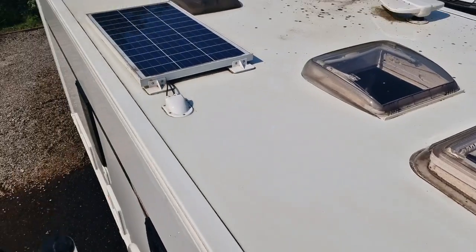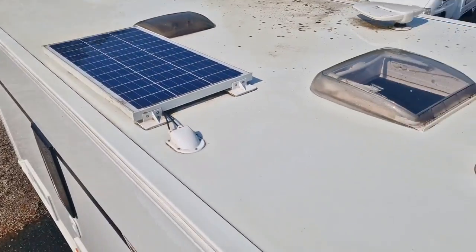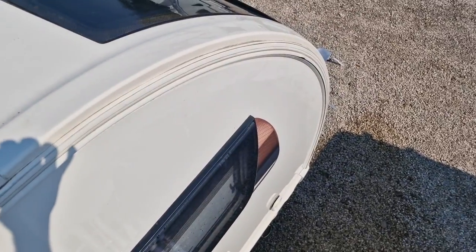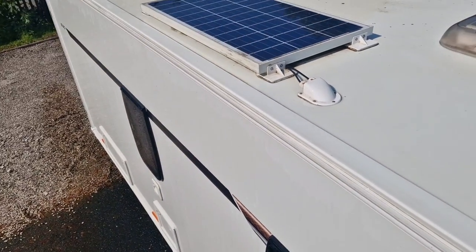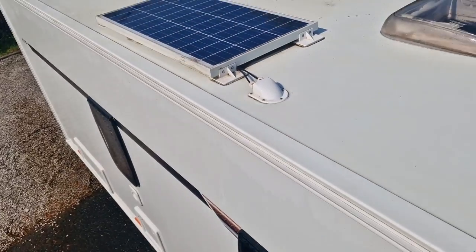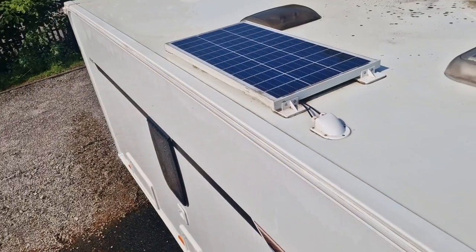That is one half of the roof done. It's taken about 40 minutes to do the whole half. It's a warm day today, not the best ideal day to be doing it. Make sure you're soaking up the sides of the caravan as well so any muck running down isn't leaving big dirty marks. Just keep wetting the sides, front, and back as you're going around so you're not creating yourself more work on the sides. The scraper and the little foam scouring pad work really, really well.